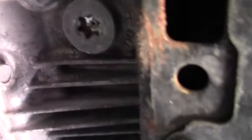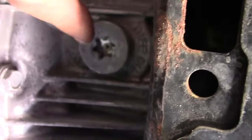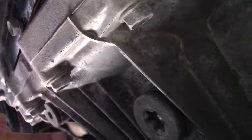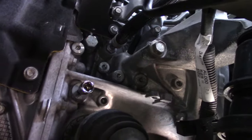I had to take that cover off. As you can see, it does say 'diff oil' right here — that is the drain plug for the oil. This is the check plug. Do not touch the fill plug again — the fill plug is over here. I couldn't get at it between the transmission and the catalytic converter because the cover was in the way. So again: the drain plug, check plug, and fill plug are right there with the socket in it.